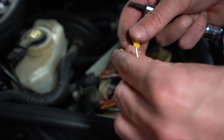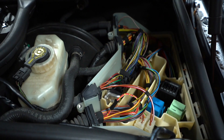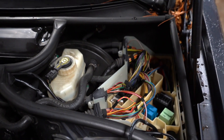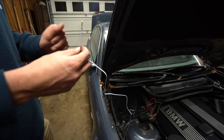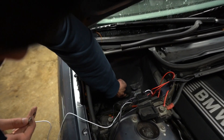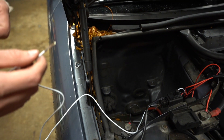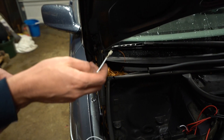You want to tap into that cable with one of these tap-style connectors — it should come in the kit. You squeeze it around the cable and plug in the spade connector into it. Then take this white wire — this is only if you want the angel eyes to fade on and off when you unlock and lock the car. You're going to feed it through the firewall right here — you'll have to cut it open with something to feed it through.